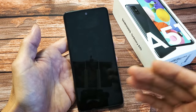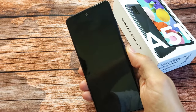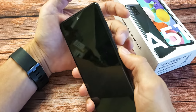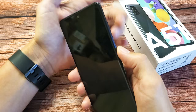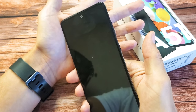Let's start off with the first step. We're going to force it to restart. You're not going to lose any data or any information or anything like that. So how do you do a forced restart? It's a two key combination. What we want to do is press and hold the volume down and the side button — or power button or Bixby button, whatever you want to call it — at the same time. Do not let go until we see the Samsung logo appear, then we can let go.